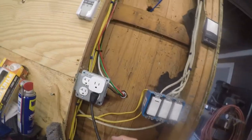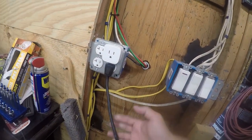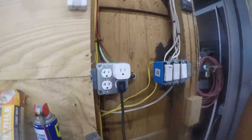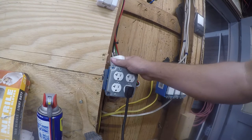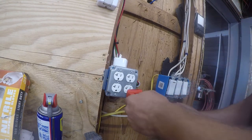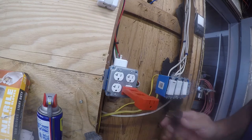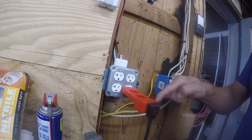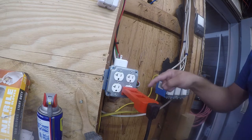The problem you run into with a classic corded appliance is: here's the cord — how are you going to measure that? Are you going to take it apart? No. So here's what you do: you unplug the appliance, plug the amp loop in, then plug the appliance into the loop. Now the current is running through here.